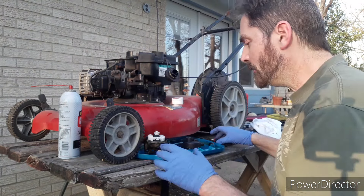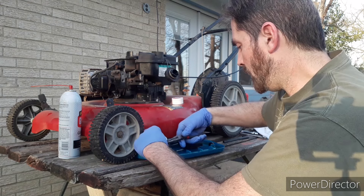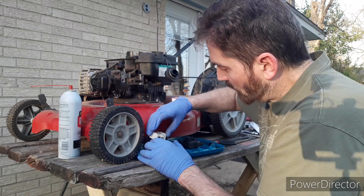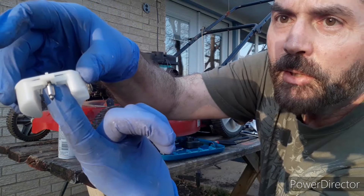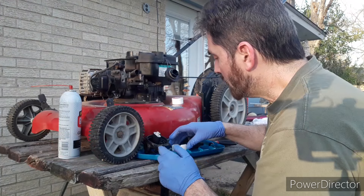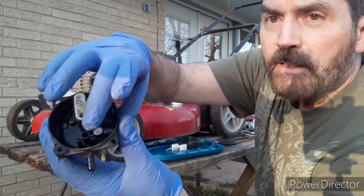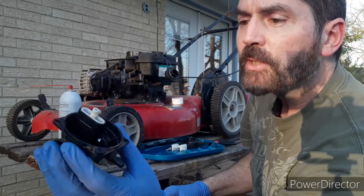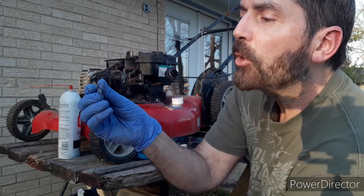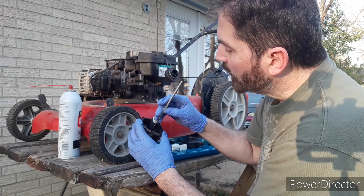Sliding the pin out. This is the float, and this is the needle I was talking about — this little guy right there. Make sure it is clean and free of gunk. Don't lose this. There's a little brass fitting in there — what we need to make sure is clean and free of obstructions. This is the needle probe I was talking about. You can get these in kits of hooks and probes at the hardware store or automotive store — not too expensive. If you're doing a lot of this kind of work, it really helps to have these.